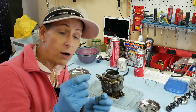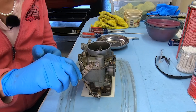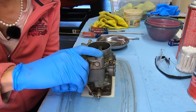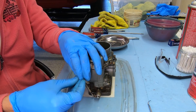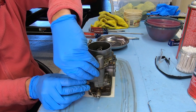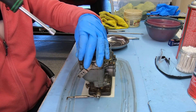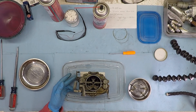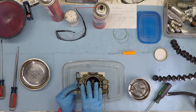There should be a little lock washer underneath every one of these bolts. Before I take the last couple of bolts out, I'm going to disconnect the accelerator pump — there's just a little teeny clip here. These are tiny parts, so hold on to them as you take it apart. It's just a clip, then a washer, then a spring. The last bolt on the left side also has an arm holding the return spring for the throttle bodies, so we'll go ahead and take that off.